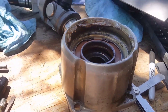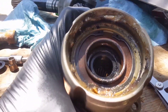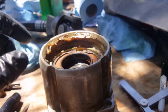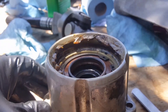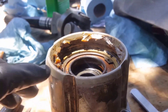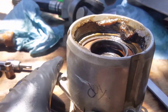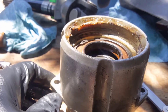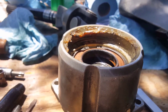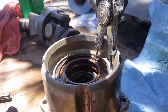Pretty bad, right? That seal is definitely not working. There's a lot of grease around this area — you can tell there's been maybe an overabundance of greasing when they did their U-joints, but yeah, it's no good. You can see right there we need to get this spring out, so let's go ahead and grab our tool.